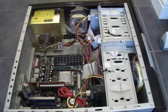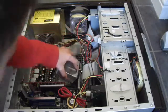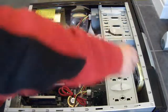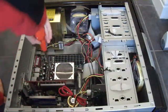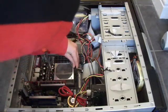So replacing the heatsink — what you do is clip it onto this side. It snaps onto that clip, then line it all up and snap this forward halfway. Put your screwdriver back in here and push down. If it doesn't go in, put that down a little bit more.